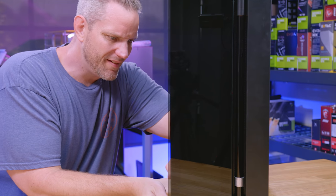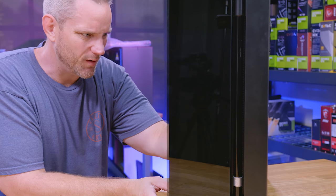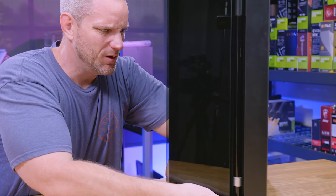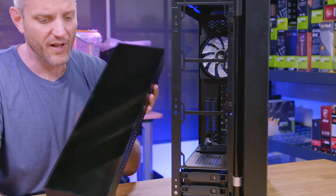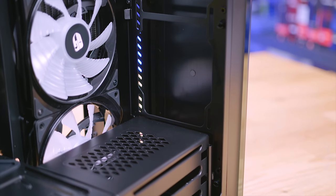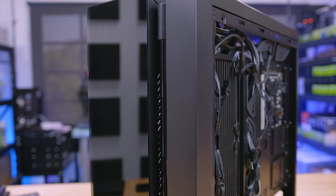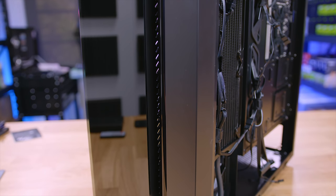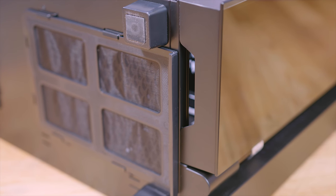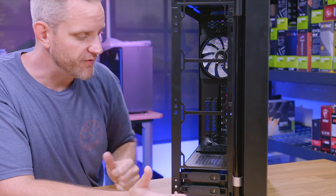The front of this is not coming apart nearly as easy as I had hoped. There are some tabs here on the inside that hook onto where the fans would go, and the metal is just kind of flexing around and not unhooking. The tempered glass is actually attached to this solid panel. If you're going to be putting on front fans, keep in mind the only place it's going to get air is through an opening at the top, these very restrictive slits on the side, and a little cutout on the bottom. You could put three 120mm fans right here — I don't see any mounting holes for 140s, so only 120s are going to fit in the front.